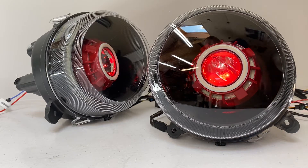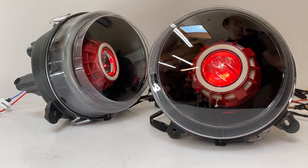Let's start with the devil eyes. Devil eyes are a small LED that we mount inside the lens — this is not your actual driving beam, just a small LED built for show. Your actual driving beam is coming out of the same section, but it's a 6000k HID bulb with a 35-watt ballast and a wiring harness.